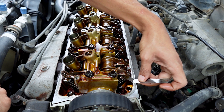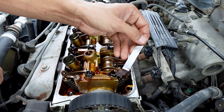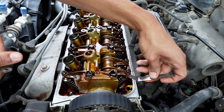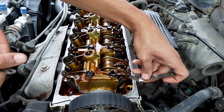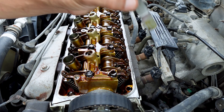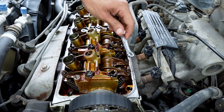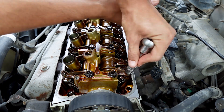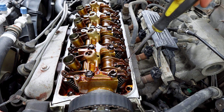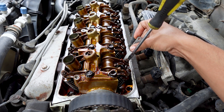See how it's loose — it needs to be a little bit tighter. It's supposed to have just some slight drag and this basically has no drag. It's supposed to be seven thousandths — I'm going to try the eight thousandths; it shouldn't fit but it does fit. And the nine thousandths fits also, so this is obviously too loose. The exhaust side — nine thousandths should be for the exhaust — put that in there, super loose. To adjust, go ahead and loosen up the locking nut.